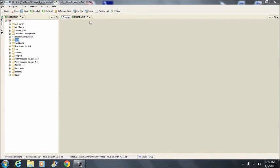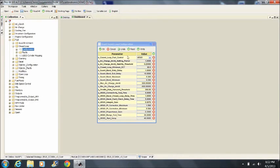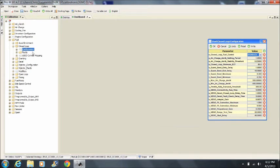Next, let's fine-tune the low flow rate for the fuel injectors. This is pretty easy to do. Run the engine until it's up to operating temperature. With the engine at idle, switch over to the working page and switch closed-loop fuel control to disabled. Then watch the wideband O2 sensors as you adjust the low flow rating until stoichiometric air-to-fuel ratio is achieved.